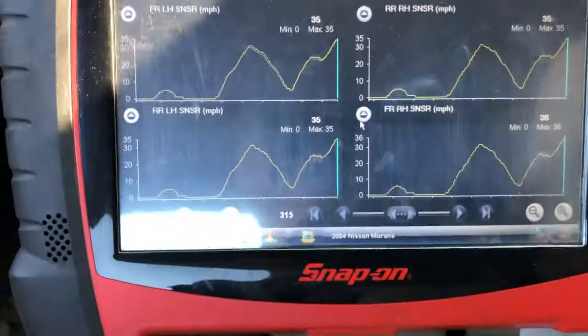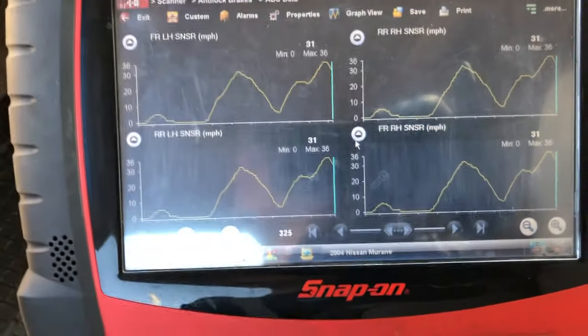That's it — a quick and easy way to check your ABS wheel speed sensors. One thing you could have done is swap the left rear for the right rear sensor and check for changes on the scanner, but I didn't want to risk breaking the clips on the frame rail. The voltage check and resistance check are enough to confirm a bad sensor. This works on pretty much any wheel speed sensor. Hopefully you learned something — don't forget to like, share, and leave a comment. See you on the next one, homies — peace out.